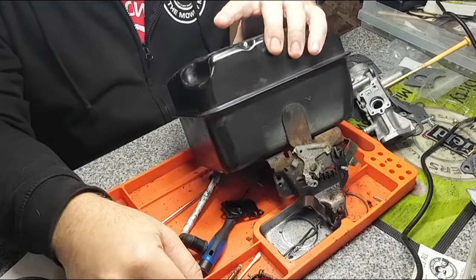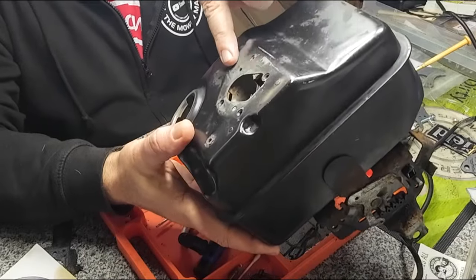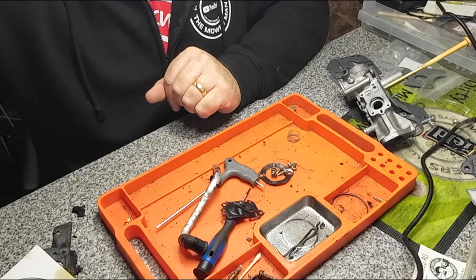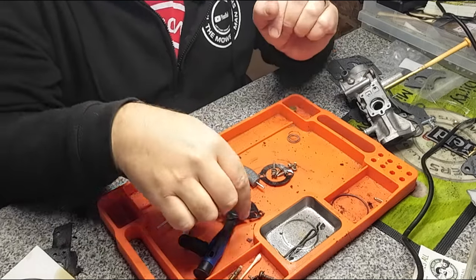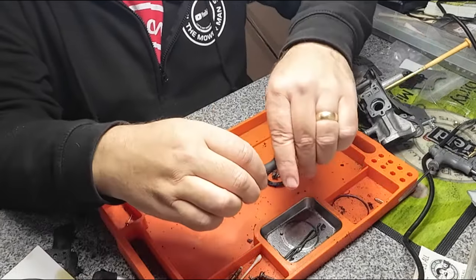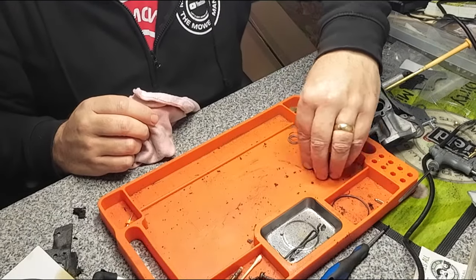Right, so it's the next day. Tank has been swilled out, cleaned, and I've just got a scalpel on the top there to remove a gasket off of that. So that's all done and been draining out overnight, so there's no fuel in there. Carburetor is now done as well. It went in the ultrasonic cleaner for about an hour and 20 minutes, something like that,